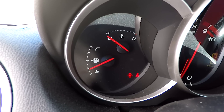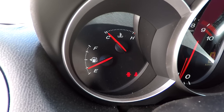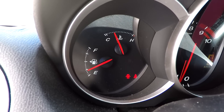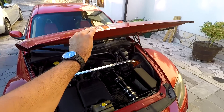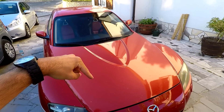Next up: let the car warm up before driving it. This way you'll make sure that the engine and all the fluids are in optimal operating condition. Also, never shut down a cold engine if you have a weak ignition system, because this way you can flood your engine. And there you have it — 10 ways to eliminate most of the problems that the RX-8 throws at you. All links to videos and items are in the description, so make sure you check them out.